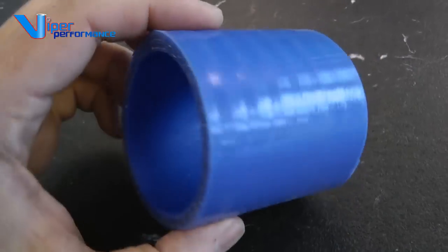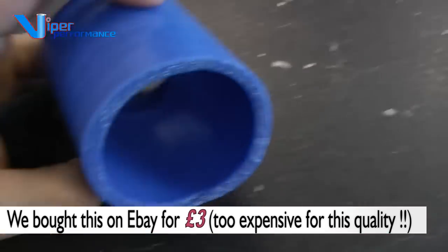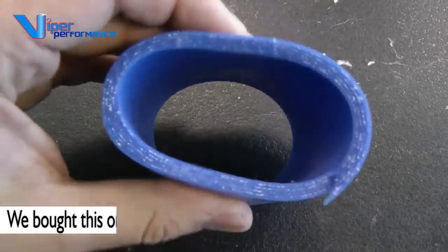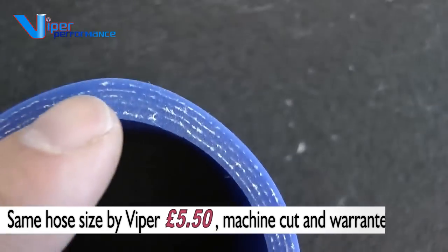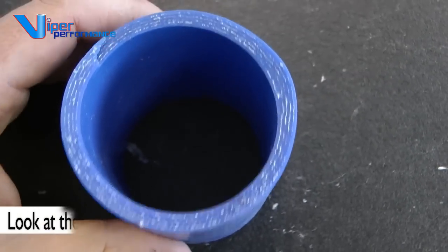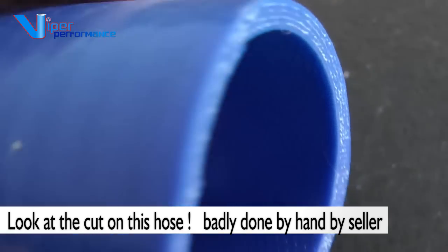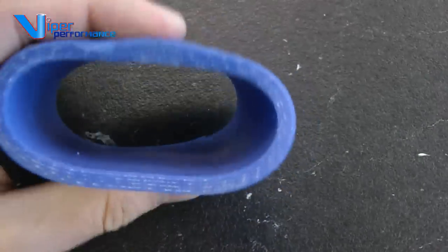There is another example of a very pale blue colour. When you compare that to the other blue there is a distinct cheapness in the pigment. This blue material is inexpensive, it's not very well moulded, and you will notice some overlaps here on the layers. These overlaps cause an uneven surface around the hose and make clamping actually quite difficult. It will leak eventually and will not give you a nice tight seal. Also, the interior of the hose is not best moulded here. Generally the hardness is okay and the feel is okay, but I wouldn't want to plumb that into a race car or an expensive engine.